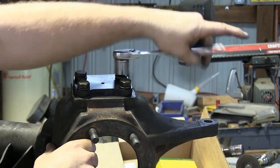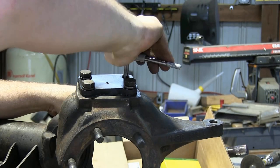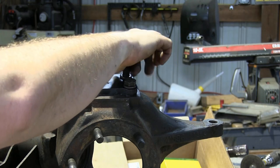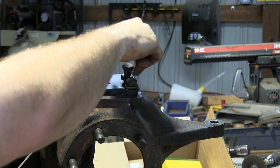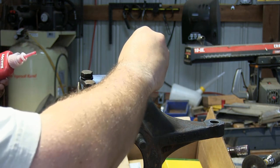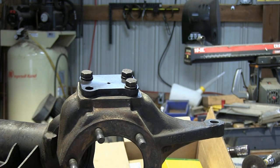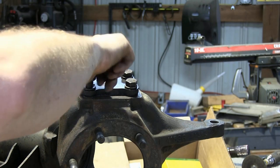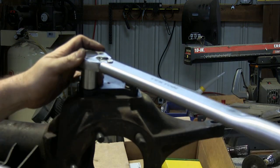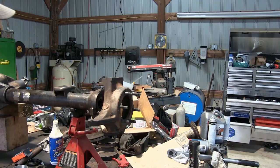Take your time — it'll finally go. Now we're just going to install our four bolts. One bolt didn't feel right, so I went and got another one. This hole doesn't feel quite right either, so I'm just going to chase these threads with a tap — oh, that feels much better. Now that I've got them all started, I'm going to take them out one at a time and put just a little bit of red Loctite on them. Reason I didn't put Loctite on first was just in case I ran into that problem — I wanted to make sure everything lined up first.